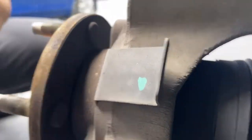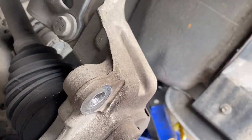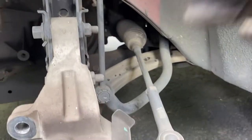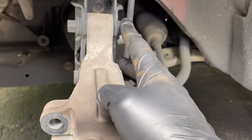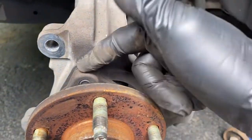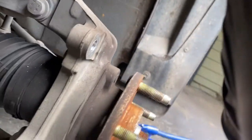You can access it from here. I think we have enough room to take it off, so maybe we don't have to remove that spindle. I'm just gonna remove the axle nut and then remove these three bolts - one, two, three - and access it from the back.